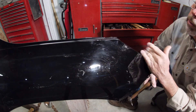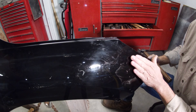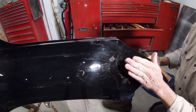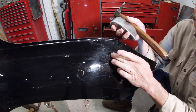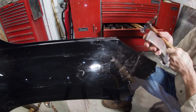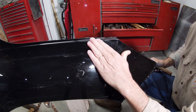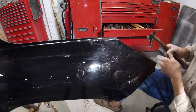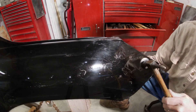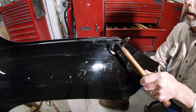It's actually feeling pretty good — it's not going to take a whole lot more work to get this ready for Bondo. These eyebrows will usually be a little bit tougher to get out than the main dent, and I can still feel it a little bit in here. I've been taking the heavy dolly, pushing above that little high spot, hammering on it, then coming down below it and pushing on it — that'll help work it out without overstretching it. By relieving this eyebrow, that helps let this metal go back where it's supposed to, and this should come out nice and straight across the top of this fender. I've still got my heavy dolly right back here, still working on this eyebrow.